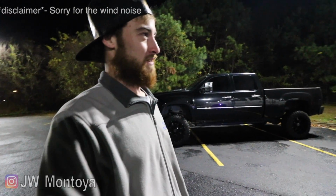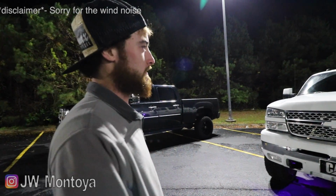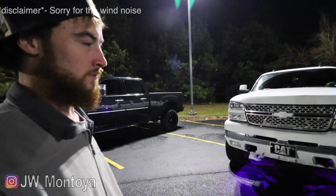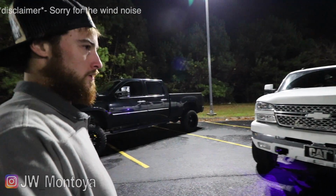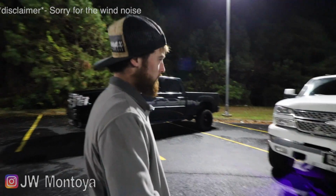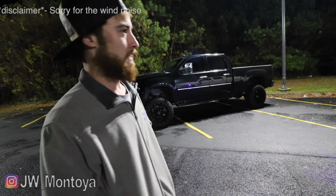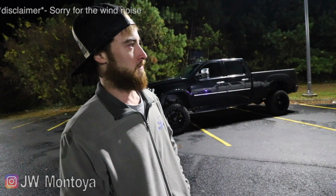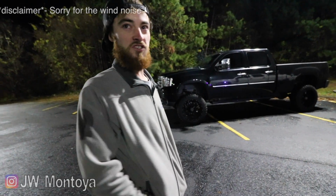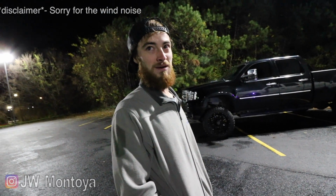Yeah. But first I noticed that my low coolant light kept coming on the dash, and I checked my coolant and it seemed fine. And then I just reset it and it kept coming on, and I kept checking the reservoir. And one day I got to work and I noticed my passenger side fender well was soaking wet, drenched with coolant. I've got a buddy I work with, he's a big Duramax fanatic, and we got to looking at it, and we saw that my coolant reservoir had some black residue in it. So we checked it out, and it was soot and a little bit of oil. And he was like, dude, I hate to tell you, but I think your head gaskets might be going.